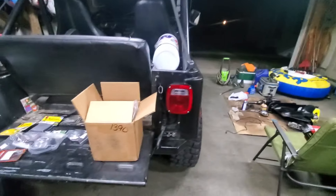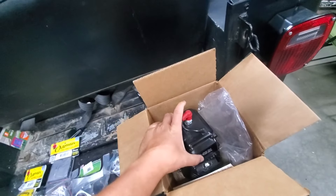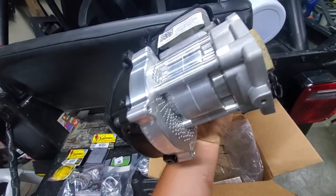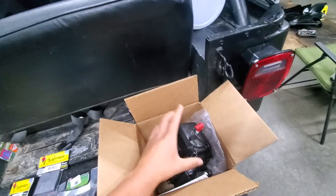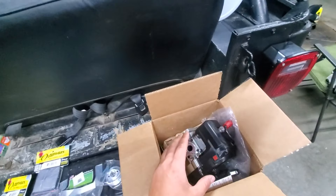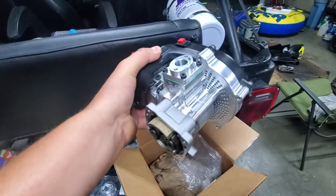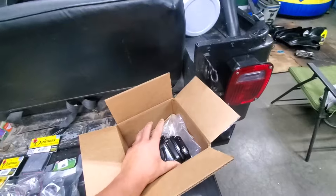So we're going to break this apart and see what's wrong with it. For new upgrades, we got our OBR motor which was custom built for us — this sucker is quite the unit, it's going to breathe way better. This motor can only run on 110 octane, so we do have some 110 octane. We were going to use our dragon fuel — they say we could use oxygenated — but that would run the motor hotter on longer runs. The OBR claims a little over nine horsepower depending on your pipe setup.